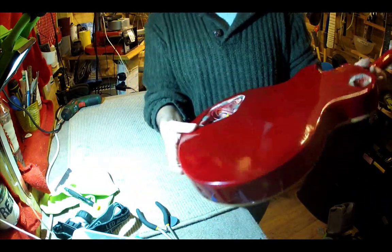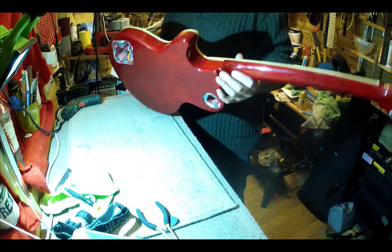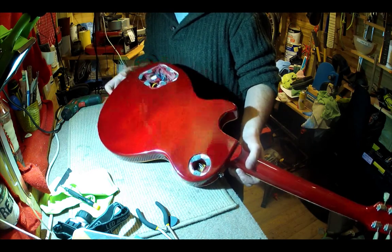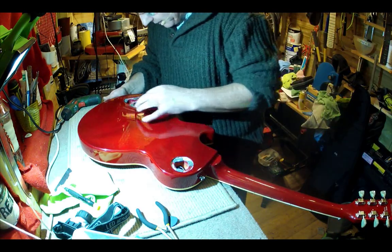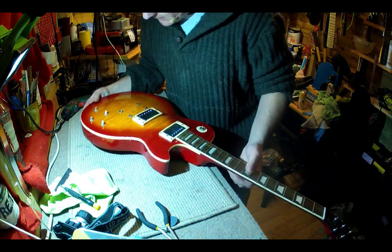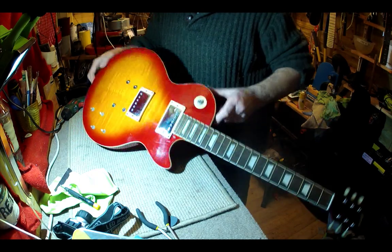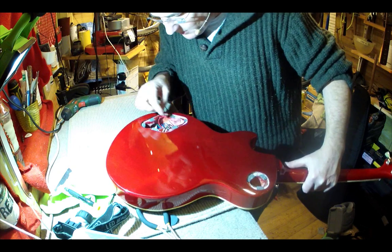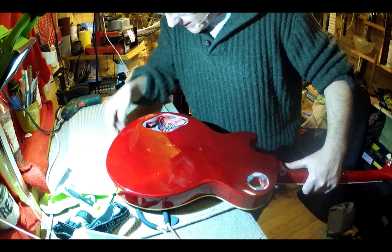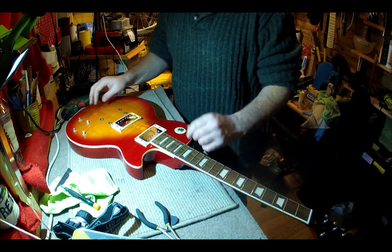But on a lighter note, we have small pots here. It doesn't look too bad, it's nothing extraordinary, but it's a competent, basic setup in there. I'm just interested in trying to find out somewhere along the line why the earth doesn't feel right. So I'm going to, not right now, but when it comes down to it, spend some time poking my way through all of this to see if there's something awry. I may only find it if I take these out, but there'll usually be an earth wire from one of these corner posts going into the top of one of these pots. In fact, that's probably it there, but I don't know how well seated it is on the mounting post. But anyway, I'll come to that a bit later on.